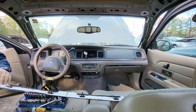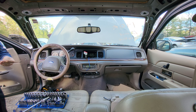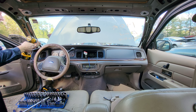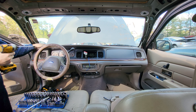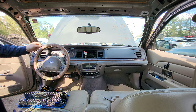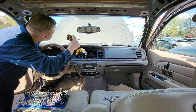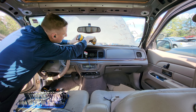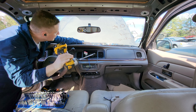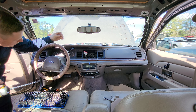If you have an older car where the sun load meter is over on the other side, you'll have to unplug on that side too. Use a little screwdriver for the clips — sometimes these little clips can be hard to push when they're in a funky position. This is just a push release. All the 7mm screws are the same, so you don't need to sort them — just put them in a tray and then put them back as you reinstall.